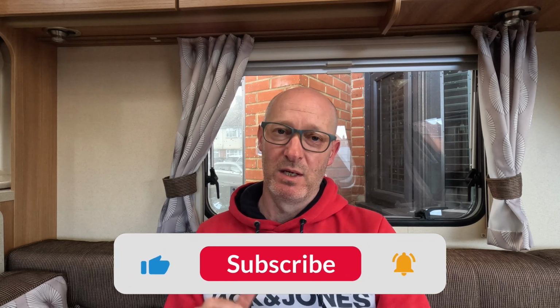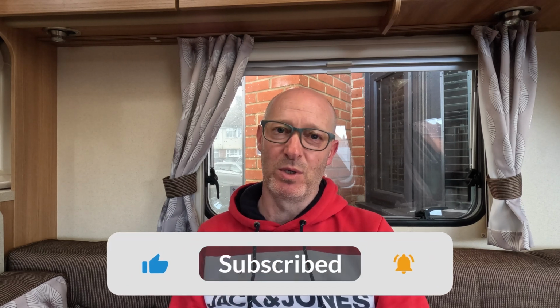As I pointed out at one of the points in the video, I left the system primed, so it had water in the system. I didn't bleed it back down when I was making the alterations there. I was quite confident and happy with what I was doing. I was only taking the screws out and putting the additional spacers in. But if you were looking to shorten the pipe or check any of the connections, then I highly recommend turning the water pump off and draining the system down.